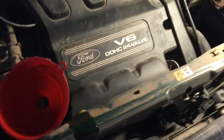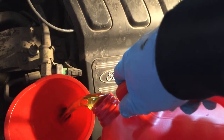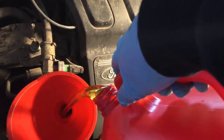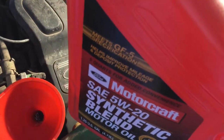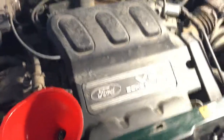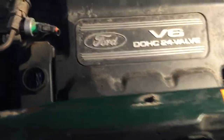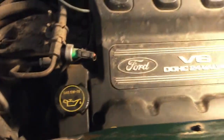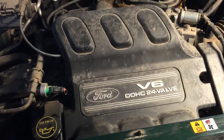I have a five-quart jug but I'm not going to pour the whole thing in just yet — I'm going to pour most of it in, but remember my oil drain valve does not drain the entire oil pan, so I don't want to overfill with oil. That important step of removing the funnel — I'm going to replace the oil cap, get it on all the way, and we will start up the engine and let the oil work its way through everything, then kill the engine and check the oil levels.